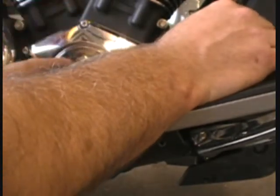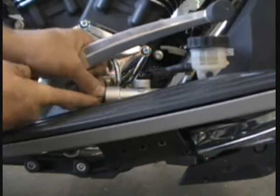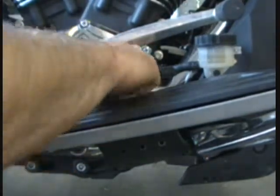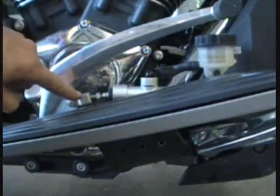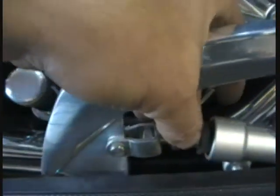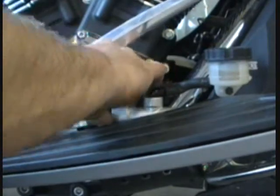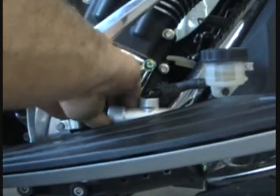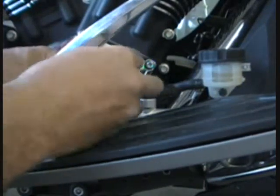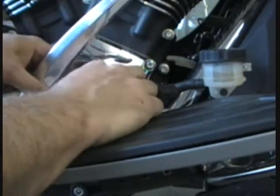So we need to get that off. We loosen that jam nut up. Sometimes this little rubber gasket here gets in the way — you can kind of push it back, just don't tear it. You want to take that hex right there and just spin it to unscrew it. There's a nut inside here that you can't get a wrench on, so what you want to do is just keep spinning this, just like you're unscrewing a bolt, and it'll come right out. Now watch — the nut just fell out of that bracket. Take this and jiggle it out, pull that out. Now your pedal's completely loose in there.